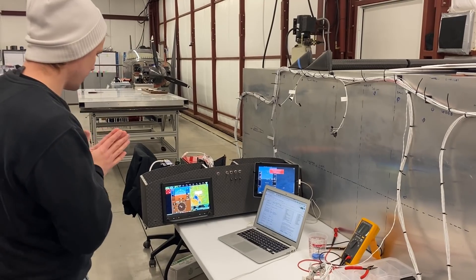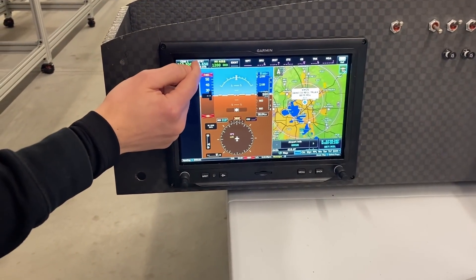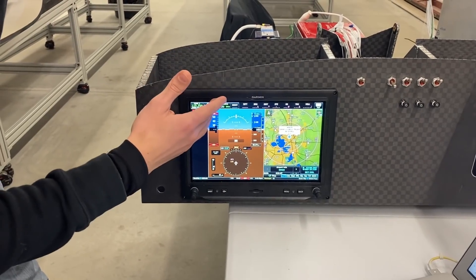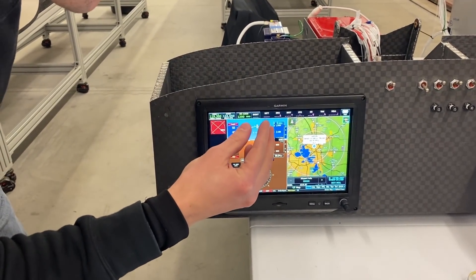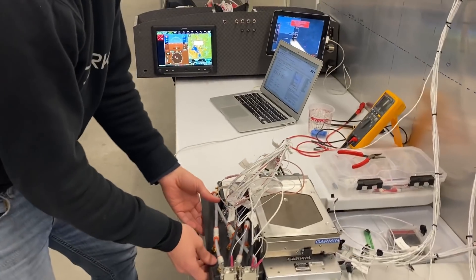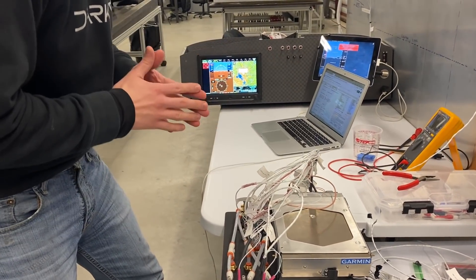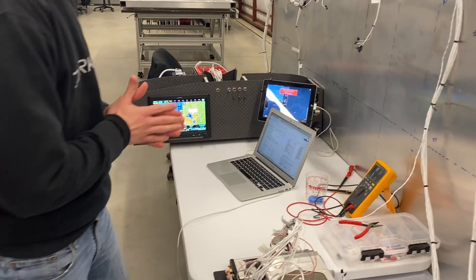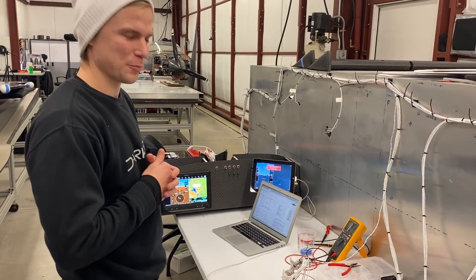To show you a quick demo — you can see in our G3X Touch interface we've got our comm radio toggles in the top left and our transponder toggles up here. These wouldn't show up if I wasn't communicating with those boxes over there. All of that data is being driven into this one interface so I can toggle those modules from here. And then we have our ADAHRS unit — I'll do a quick demo by tilting it up and down, and you can see that it's reflecting on the display accordingly. Not just the G3X, but also through our backup unit driven through a tablet display. The tablet display we have right now is pretty old, but we'll upgrade that down the road.